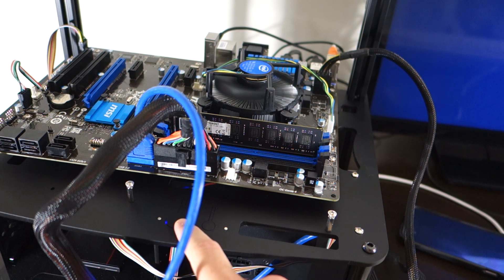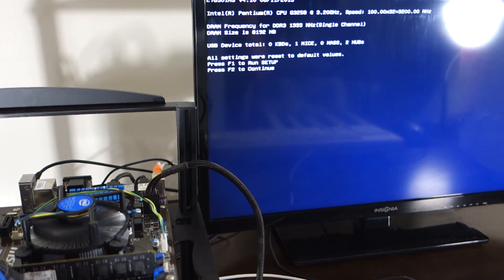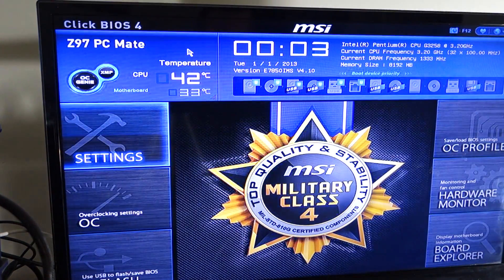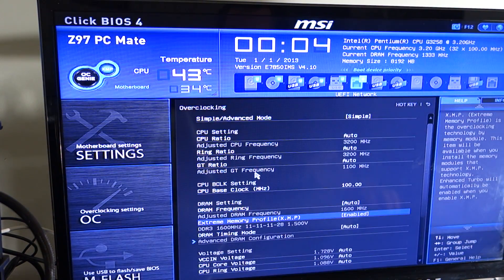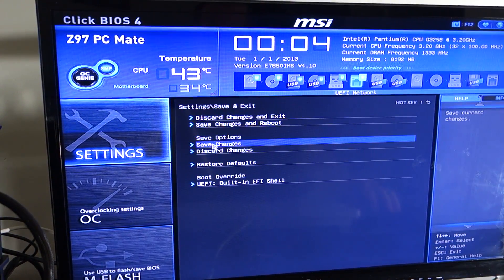I did not like that. Oh, it's spinning — there's a signal. I hear a really high-pitched noise coming from, I think, the CPU cooler. The camera battery died, but the high-pitched noise was actually from my power supply's fan, which sucks, but it's nice that it's not the CPU cooler or anything wrong with the motherboard. I got the BIOS to pop up. I'm a dumbass and I plugged my keyboard into the wrong PS2 port — shame on me. I'm going to go in and enable XMP and restart, then we'll move on to phase two of the master plan.